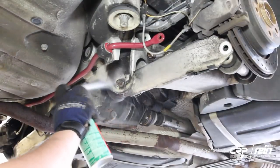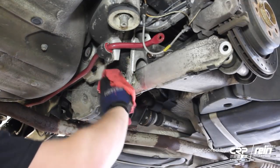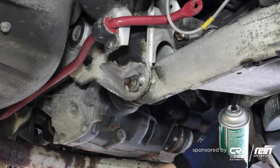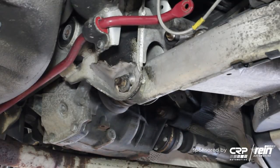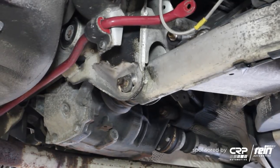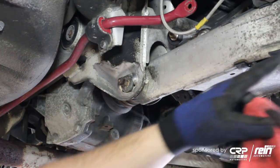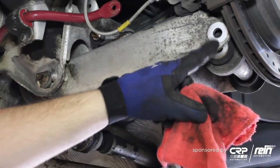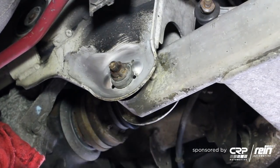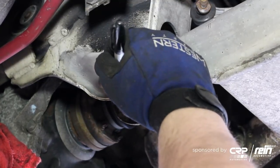is clean this down and mark where the eccentrics are lined up, because I'll actually be removing this bolt and loosening the bolt here — which is a 16 millimeter — and the entire swing arm will just droop right down. BMW says if you're doing this rear ball joint you should have alignment checked anyway, so it doesn't really matter. I'd rather spare the bushings on a $400 part than take a shortcut and damage the mating area. I'm going to mark it as close to where it is right now to make it easier later — you can do this with a Sharpie.